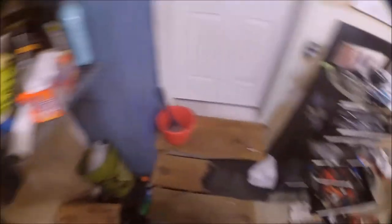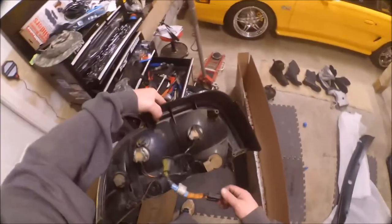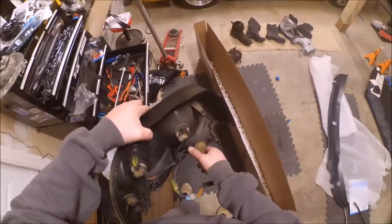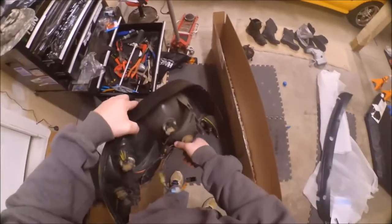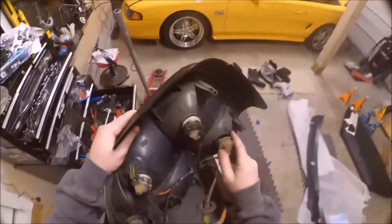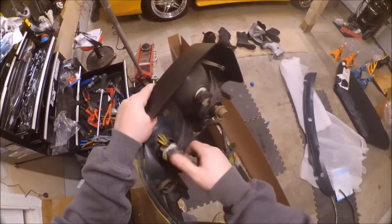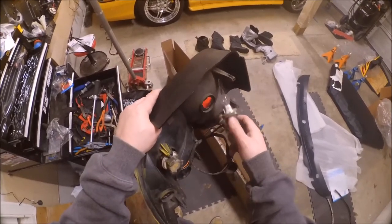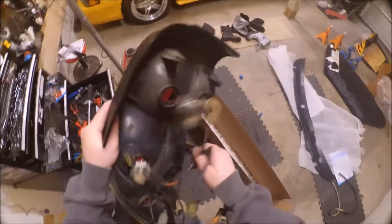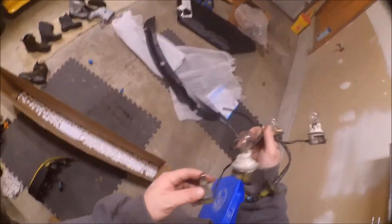We're back — I just cleaned up the tail light wells as best as I could. Now what we want to do is get the harnesses off these things. Basically all you want to do is twist these until they come out. Sorry for the hesitation — I was trying to think which bulb was out, because I do know that I have a bulb out. This is the passenger side, and this one does have the backup bulb out.